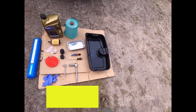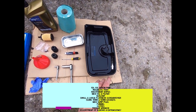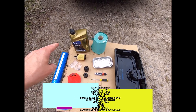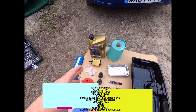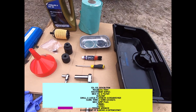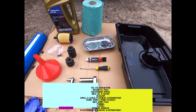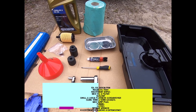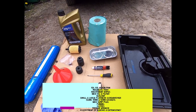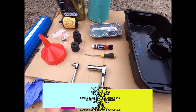In terms of kit, there's about eight and a half liters of oil held in the vehicle, so I've gone for a 10-liter oil drain tray. I've also got a magnetic tray, some absorbent towels, the new oil itself — go for the stuff recommended by VW, check the forums and Google for the spec — some black silicone sealant for the sump plug, a small screwdriver to pick off clips, and a large one for the engine cover. You'll also need a 19mm socket with wrench and a 10mm one.